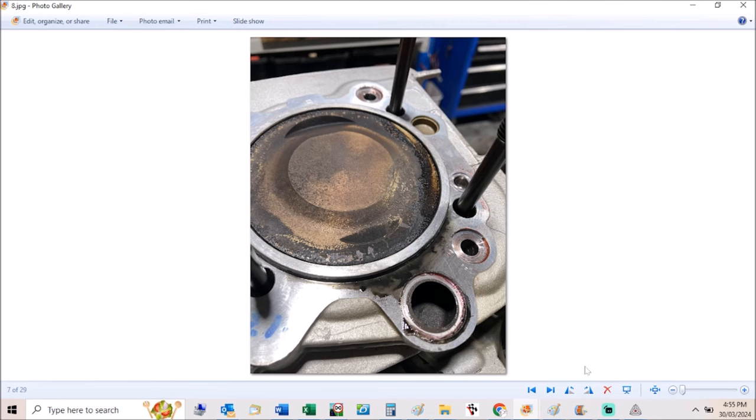When it came apart there was a little bit of staining on the top of the cylinder and on the head, just at the exhaust port, which is where these things usually leak when the heads warp compared to the cylinders. The STs and the 906s and 907s have always had an issue where they will leak oil as the kilometres get high. The cylinder heads warp and actually push oil out between the cylinder and the head, because there's no head gasket on these engines — just cylinder on head. Instead of leaking combustion gas, which they don't, they just push oil out. The STs and the 906/907 are water-cooled, and I'm guessing the water jackets mean the heads aren't as stiff as air-cooled heads. I was a little bit concerned about that.